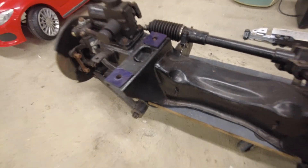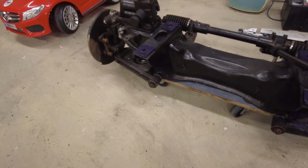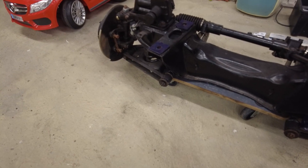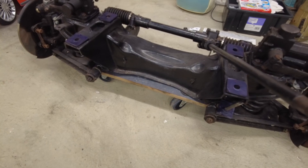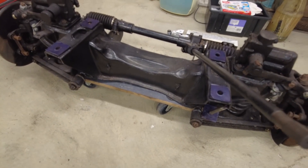I'm going to put them into service anyway folks, but I have a funny feeling I'm going to be doing a poly bush set on the front of this car. They're polyurethane and the reason I got polyurethane is because I really don't ever have to replace them again. I actually went for the ones off the MGB V8 which are a single piece rather than the two-piece ones.